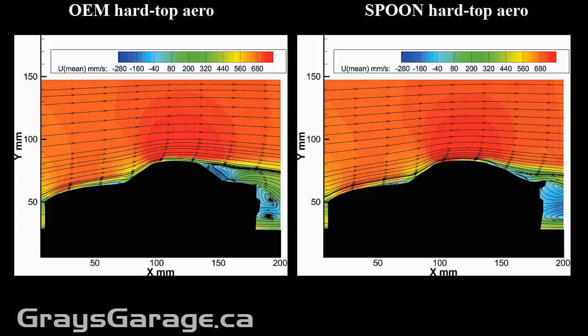And this is because of the much shallower, gentle slope. Now, the experimental velocities are not as high as on the highway, and I didn't necessarily model the rear slope perfectly. So you do still get a kind of a funny structure with periodic separation just before the rear spoiler.